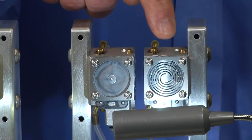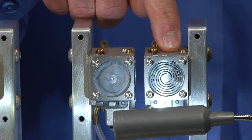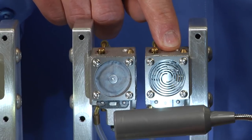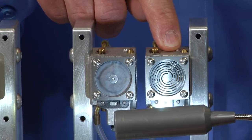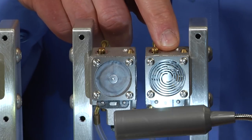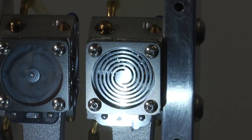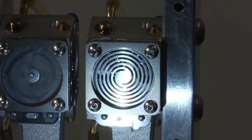We've set up this display to show you the difference between a conventional diaphragm and our new spiral diaphragm. This stainless steel spiral is a key component. It provides structure and support for the membrane. When the membrane is moved by engine vacuum, the spiral transmits this movement to open the inlet valve. We use stainless steel so that it will be impervious to ethanol and harsh fuels.